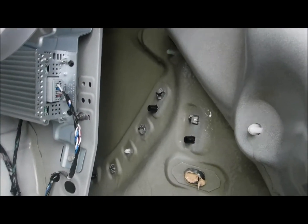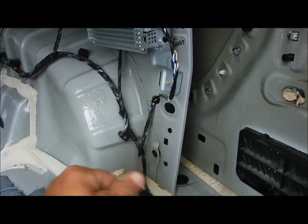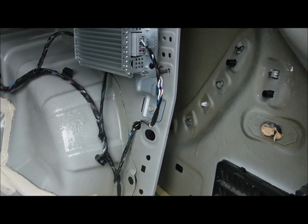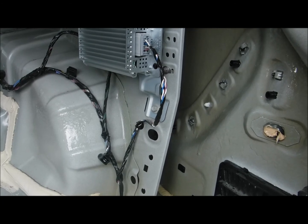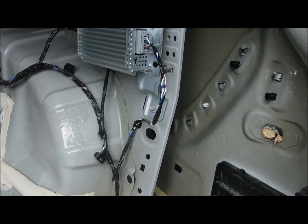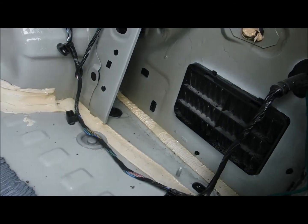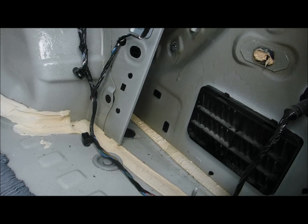Most importantly is the joints. When I mean by joints, I mean like here, that's a joint where there's two panels that come together. Make sure that's done really good. At least I do. Let that oil seep down in that crack as deep as it can go. Once rust and problems start shaping up there, it's pretty difficult to fix. So to prevent that rust from showing up is what I want to do anyhow. Here's another bolt sticking up. You see, I'm just going through it visually, inspecting everything and making little judgments of where I think the Rust Cure is most importantly needed and applying it.